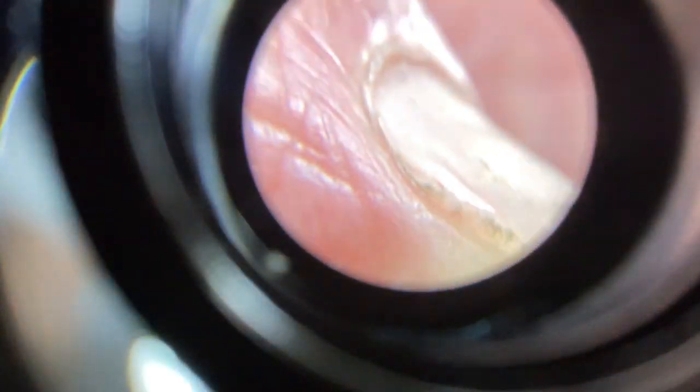You can see that cup on there? That's made to bite into the motor shaft. This is the set screw we were using — and you can see how smushed out that thing is. That's why it was not holding.